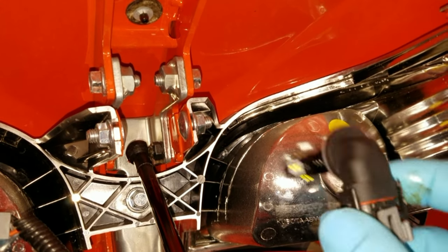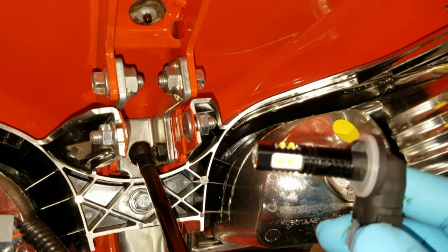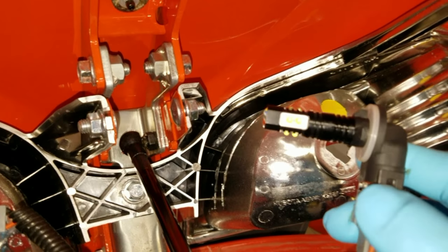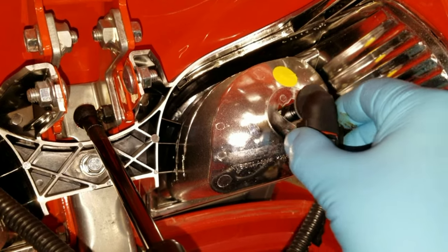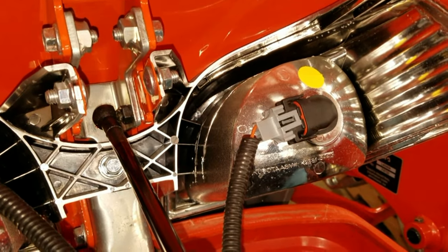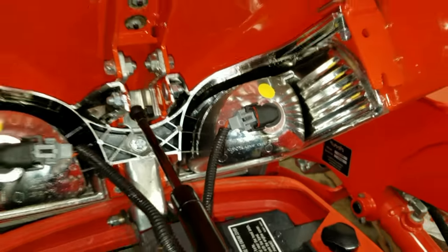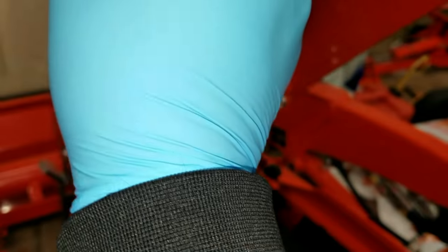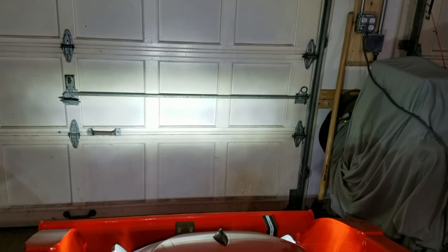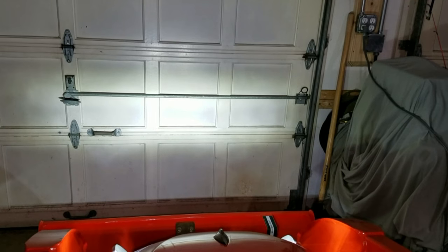It's all a pretty simple installation. After you pop the hood, just untwist the bulb carrier from the socket, then remove it from the housing and unplug the bulb from the carrier, and plug in the new one. The bulb number on the OEM fixture is 896, but this 881 bulb crosses right over to it. I'll leave a link in the description below. As you can see here, these bulbs put out a clean white light that kind of pierces through the night about twice as good as the old ones did, in my opinion.